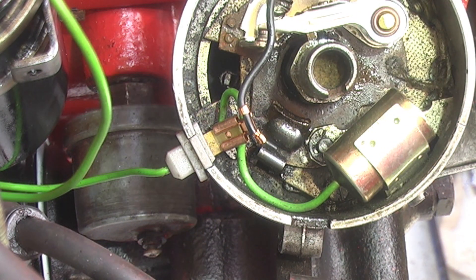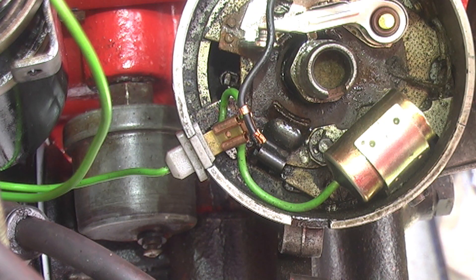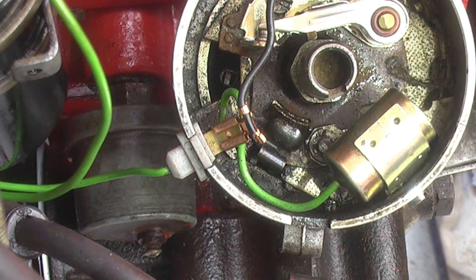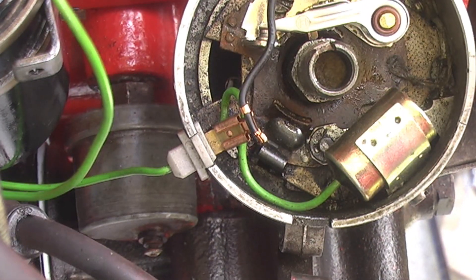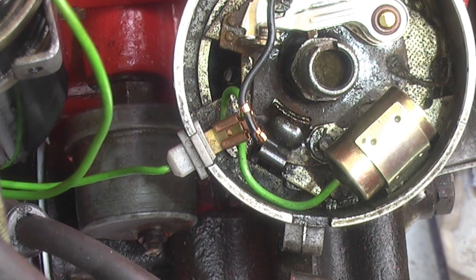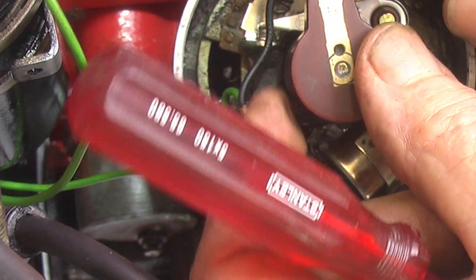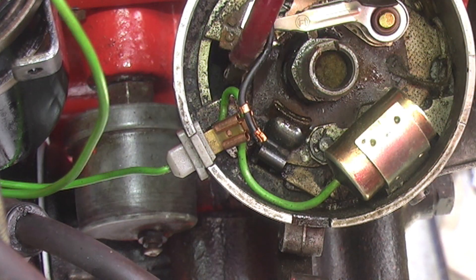How do you tell the difference between a primary and a secondary spring? This one is the secondary — see, it's loose. You can see I just pulled it in there, so you can actually jiggle it around. That's your secondary spring. That's what we would take out if it had too much advance coming in too early. But what we've got to do is tighten the other spring — the primary — because it's starting too early. So we'll adjust the primary spring. I've got to turn the engine over another turn so we can get the primary spring into view so we can adjust it.